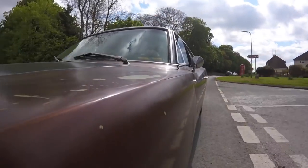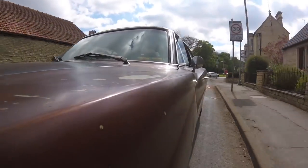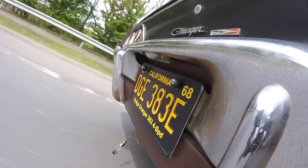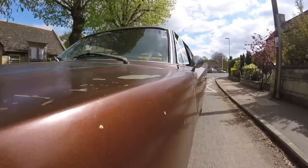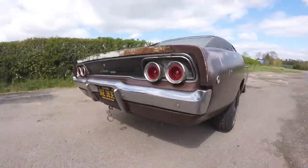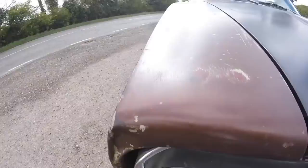I've had it nine years and I never intend to sell it unless something goes badly wrong in my life. It's a wonderful thing to drive in Britain where it's highly inappropriate. The first thing people ask me is 'I bet it handles like an absolute pig' — actually not true. We rebuilt the underneath: it's got all new torsion bars, leaves at the back from a Hemi car with an additional leaf, all new KYB shock absorbers, and all new bushes.